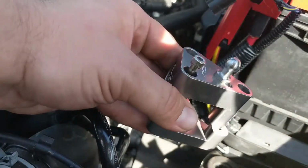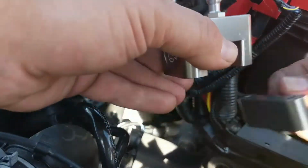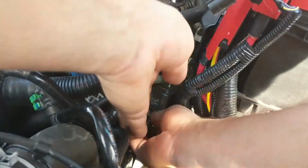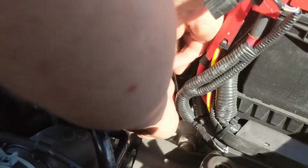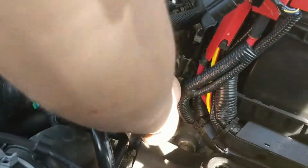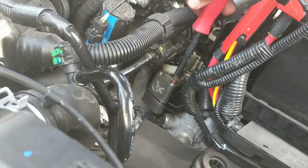After removing the shift lever from the shifter arm, take your short shift kit and remove the bolts. Start installing by placing the top portion onto the peg first, and then hold the bottom portion under the arm while inserting an initial bolt. Once the first bolt is securely fastened, insert the last two bolts. After all the bolts are inserted, go ahead and tighten them down. Now place the shift lever onto the peg.